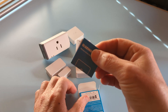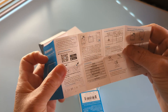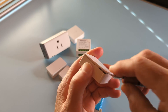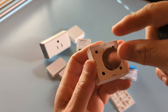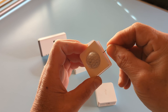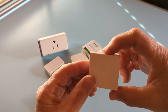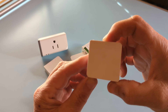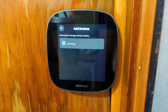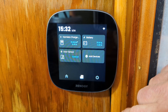The instructions in these little boxes all say to add the accessories using the DC Home app, but we found that it worked better if you just used the Renogy One monitor directly to add them, and then used the app to program the scenes themselves. To pair those accessories: open up the accessory to remove the battery tab. Using a paper clip, click the reset button so that the smart accessory will enter pairing mode. Some of them have a button on the side. Then select the middle icon on the home screen of the Renogy One, click Add Device, and when it recognizes the device, click Add.